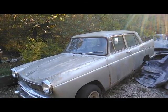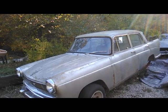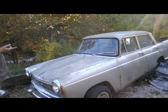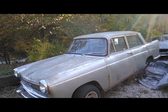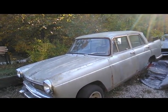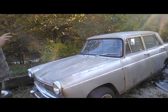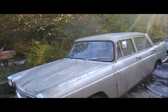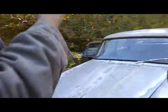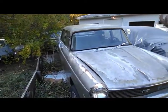After driving it all winter long in Indiana 4 or 5 years, it started getting pretty rough. I quit driving it because the clutch went out, and the floors are all gone, and that British stuff... I put the Dodge motor and tranny in it, and it holds up pretty good, but every place you weld a shock mount or a bracket on, you had to put a piece of steel plate about this big to mount it to. You can't just hook it to the British steel. I pulled a foot of the original frame rail out from under this car on the front spring hanger.